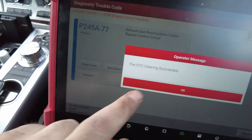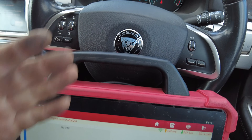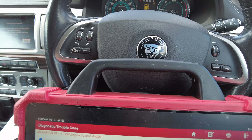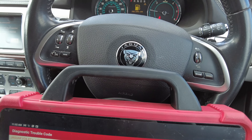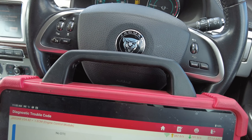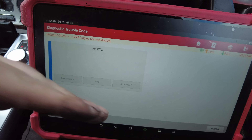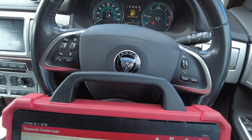With that little temporary repair working, that fault code has now turned around to a historical fault, so we're going to go ahead, give it a clear - we've got no DTCs. We're going to take the car for a little bit of a test drive because the customer called in previously and somebody else had a little plug in, said 'oh yeah' and cleared it and off they went, and we came back about 20 minutes later and the lights came back on. So I'm going to make sure that this repair is perfect.